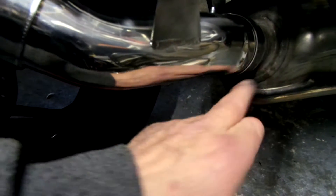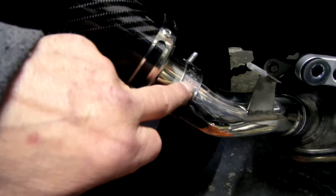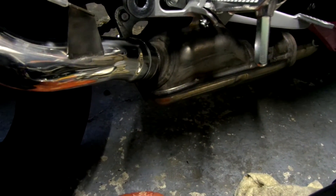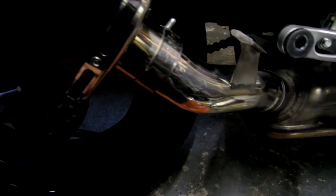I've put some sealing compound on the inside of this because it's a bit floppy. This one's okay - it's got its own Suzuki bush on there, that tightens up no problem. That's just a matter of getting it all in line where you're happy. Unfortunately I would prefer this up higher, but you can't because this dictates where it goes. You can't go too far on - it goes slacker down here, the diameter's different. I had to do it quite tight to get it to nip up, that's why I put some seal around it on the inside. So as you push it on, it goes up - I put it thicker at the back. I tried not to get it to come out the splits here. That seems solid, because before it was a bit wafferty, a bit wiggly.